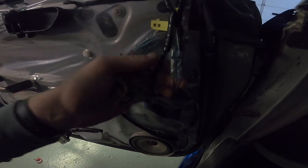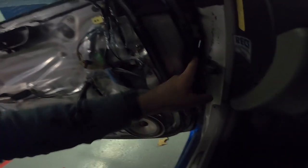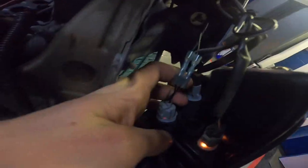All right guys, I got the car in here — it's actually the next day but I did the driver's side. Basically it's the exact same as the passenger side: we have a green and white wire coming out of the mirror, and I wired a black and gray, putting it through the boot just like I did on the other side. We got it working. Up here we ran that same wire all the way to the front and we have it spliced into our turn signal wire on the back of the headlight. There are obviously a lot of other ways you can do this, but this is just the way I did it. Be sure to like and subscribe — we'll be back for another video soon. Big news coming for the 05, so be on the lookout.